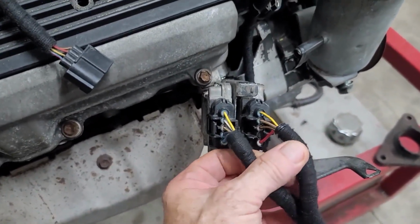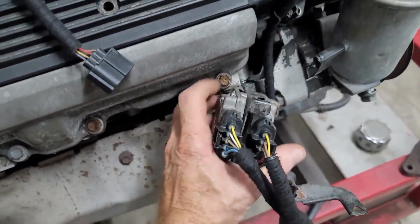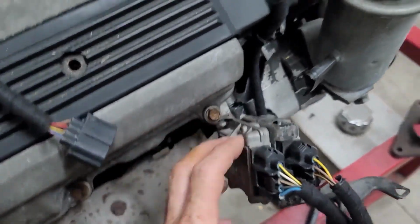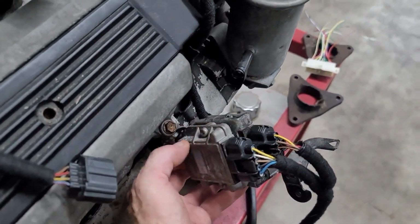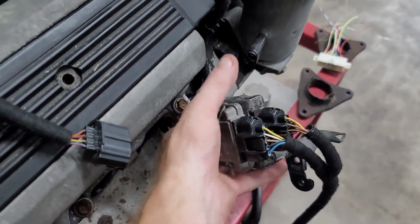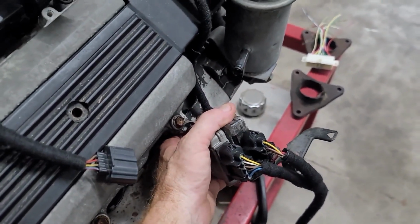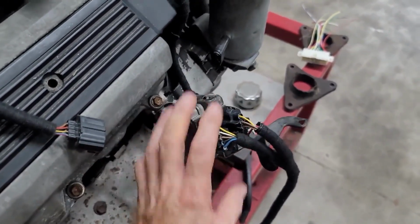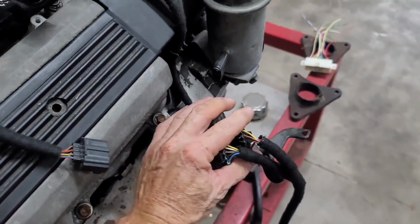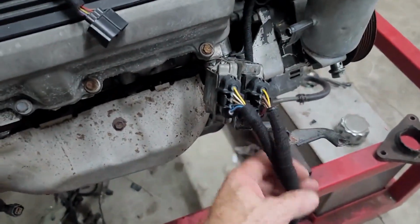So your two ignition modules or igniters, okay, make sure that the housing of these are earthed. It relies on the actual body housing for the earth. Okay, if you don't get that, it will not run. It'll give you a code 14 or a code 15, well, probably both, and she'll start and die. So it's usually a ground problem that gives those codes.